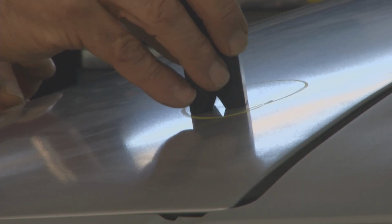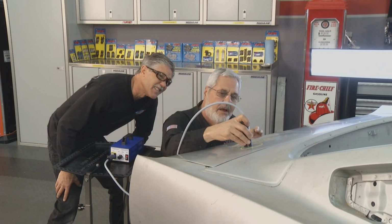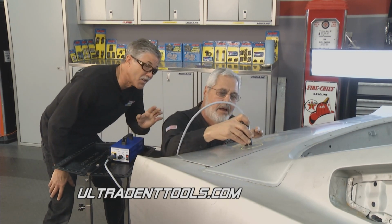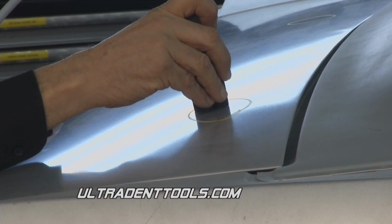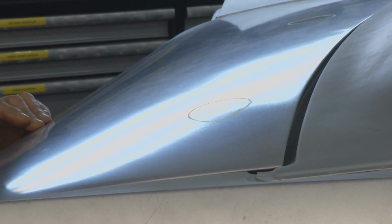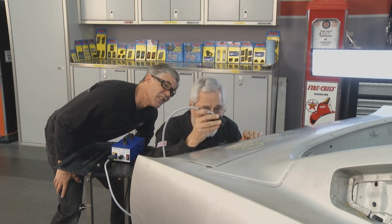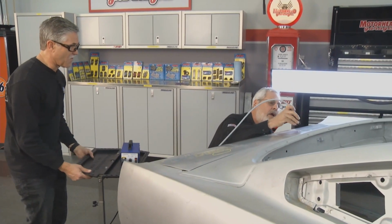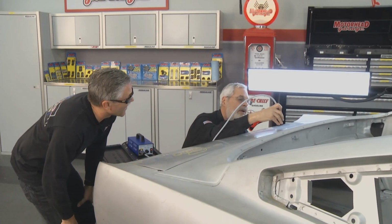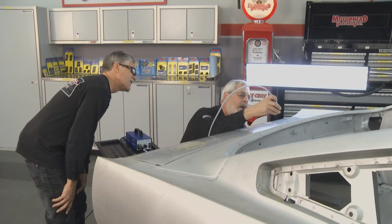Uh-huh. And just pulse it, hold it all the way. You're going to hold it until it stops. It's going to stop on its own. Okay. I felt it stop. Yeah. Hey, we're almost gone. Okay, go again. A little bit more to the right. Here? Right there, yep. Pulse it again. That's gone. Now, I've got one over here that's a little bit sharper. Okay. All right. So try that one. And you're going to want to go right in the center of that one because it's just a smaller, sharper dent. Okay, pulse it again. You can wait a few seconds between each pulse.